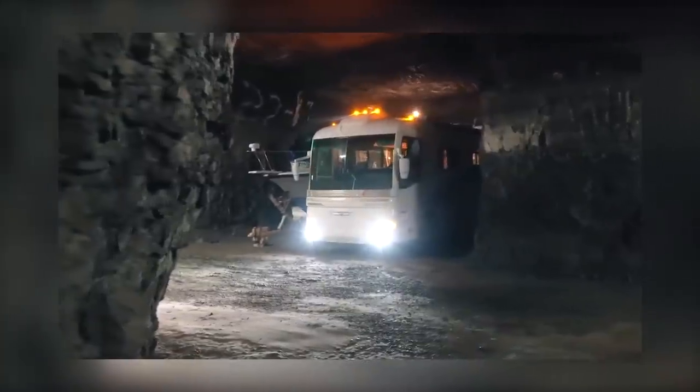It was totally fine throughout the summer. I store it in a limestone mine for the winter. It was probably October or early November here in Pennsylvania, Pittsburgh area. Some snow flurries were flying that day and I got in the RV taking it to the mines. The RV started to shake violently when I was into the throttle — the yellow check engine light and the red stop engine light both came on, flashing on and off. It was surging and bucking.